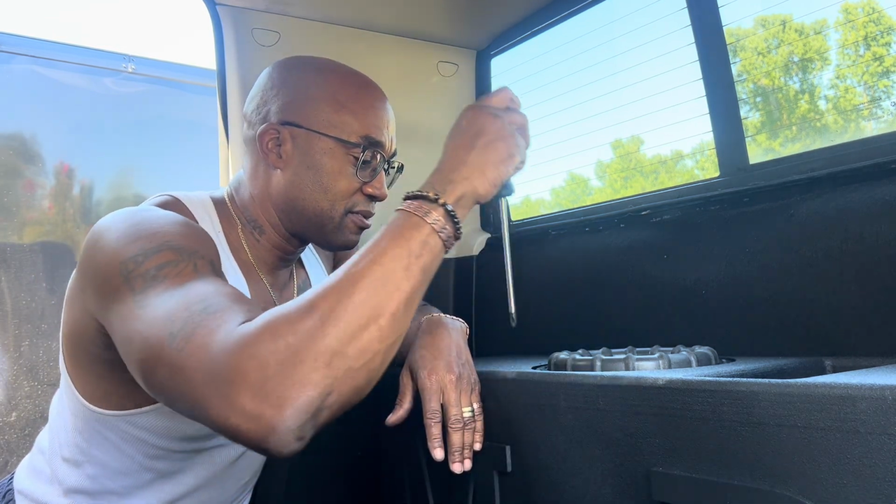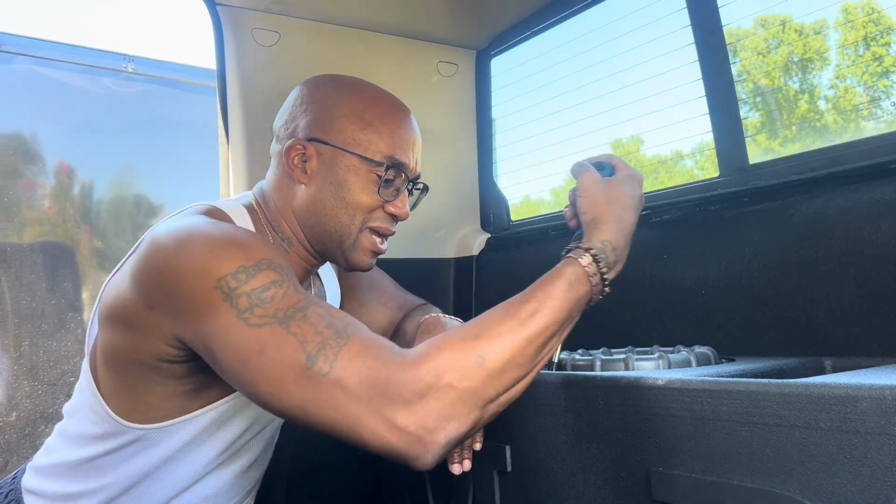I like to finish it off and tighten by hand, nice and slow. I never try to use the drill to go all the way and mount the woofer. It's just enough to get the bite and save me some time. Then I switch over to a handheld screwdriver and proceed to tighten it myself.